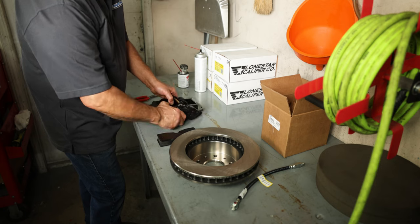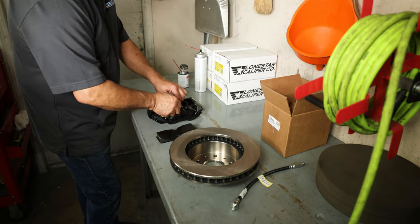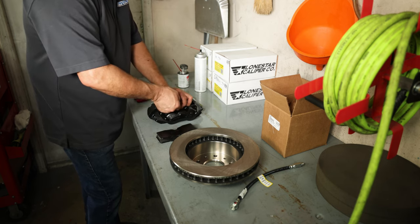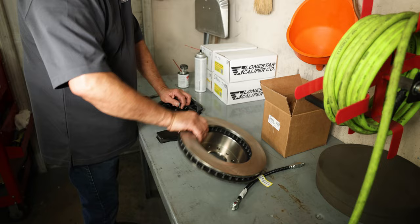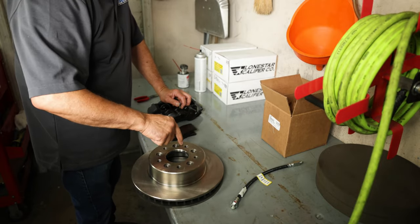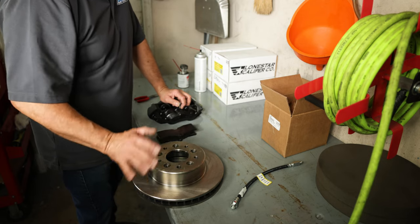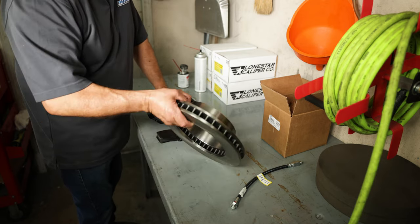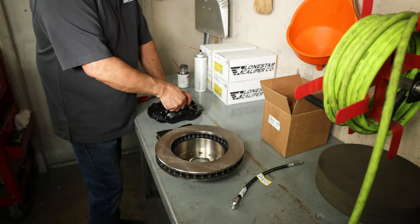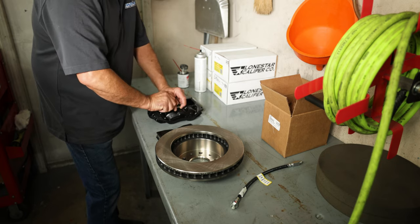Prepping the new caliper, installing the pads, and cleaning the brake rotor — do this four times; they're all pretty much the same. The only difference with the rotors is the rear has additional holes for adjusting the parking brake shoes, and the offset is just a little bit different. I've seen guys put them on incorrectly and wonder why the brakes are dragging — it's because the rotor offset is different and it's applying pressure.